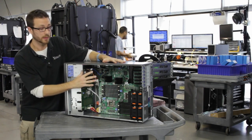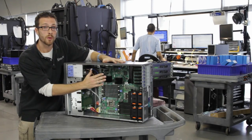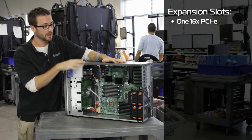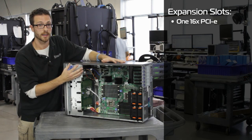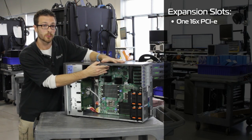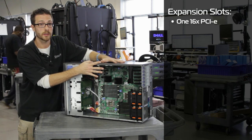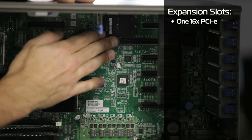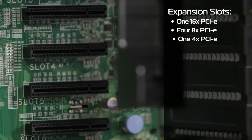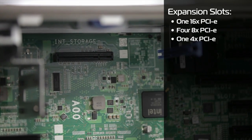This is the other part that makes the T710 different from the R710 — we've got plenty of expansion slots. We've got a 16x PCIe slot, so we can add in a video card if necessary. If we need to do any kind of 3D rendering, we can pop a card in here, though it has to be a low wattage card since there's no supplemental power. We've also got four PCIe 8x slots and one PCIe 4x slot. The internal storage slot is also a PCIe 4x slot.